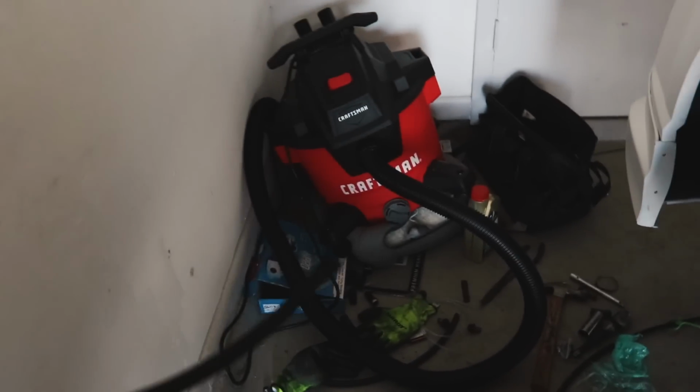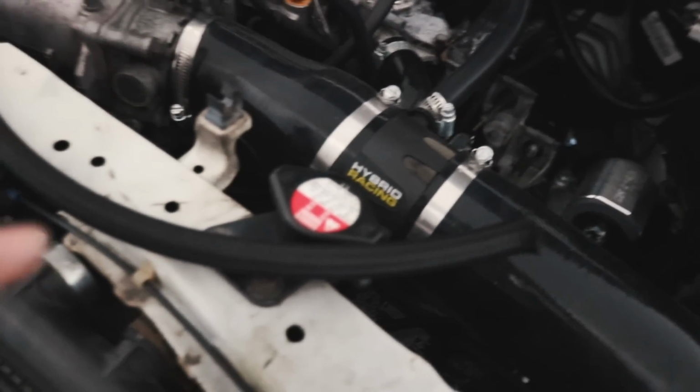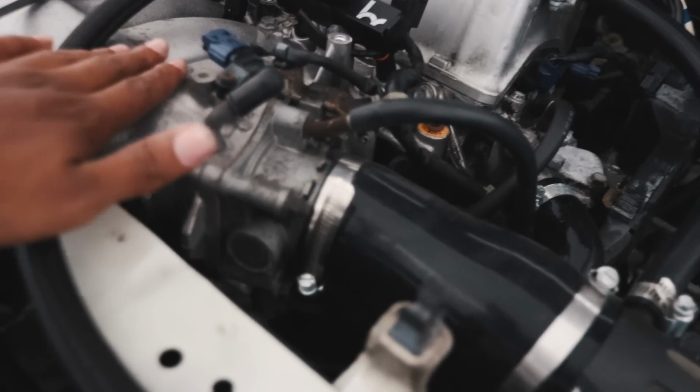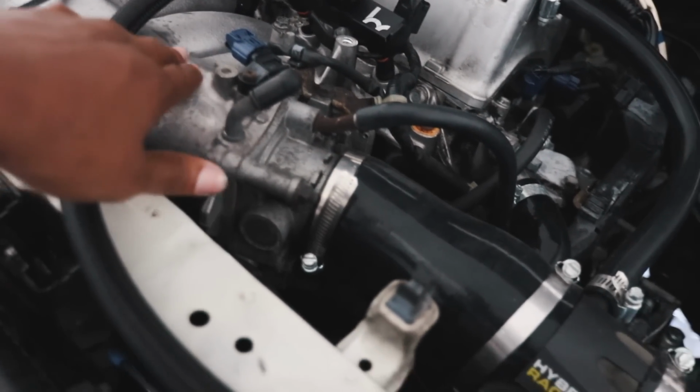So I got the check valve placed in the new dash 8 AN line hose. Now we just gotta install it. When you do the check valve for the brakes, if you are gonna run an AN hose, make sure the white piece, when you take it out from your OEM line, faces the intake manifold. If your brakes feel like ass after the fact, it's because you got it backwards. So be sure the white piece on the check valve is facing the intake manifold, and you should be good.